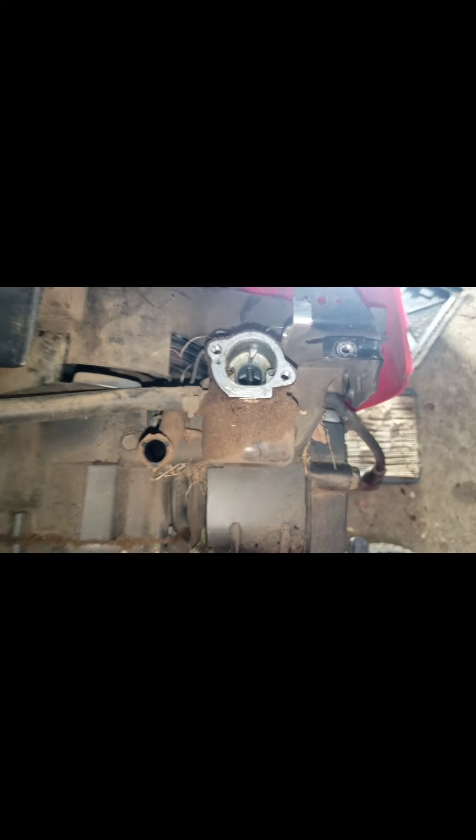What we're after today is the lady is stating that it leaks gas, and the seal on the oil cap is also bad. We'll see if we can get it fixed up. It doesn't look like there's a whole lot of oil spraying around, but you can see the bottom of that base gasket — it's weeping pretty good. That's where all the dirt has collected.